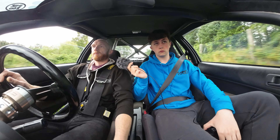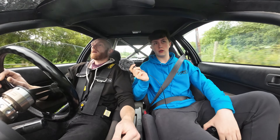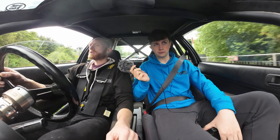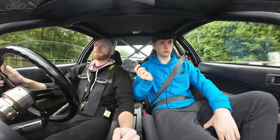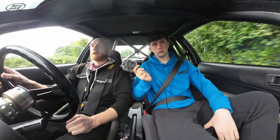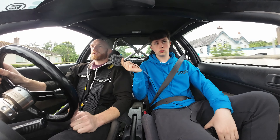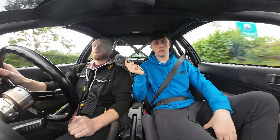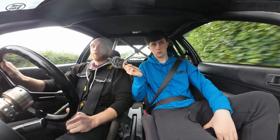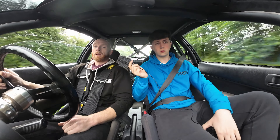It's running about 220 brake horsepower at the moment, just under, and that's to the flywheel — so just under 200 to the wheels. It does need to go back and get tuned again; it was starting to run out of injector duty, maxing out the injectors on the dyno. I've got bigger injectors and a new fuel rail to put on it.